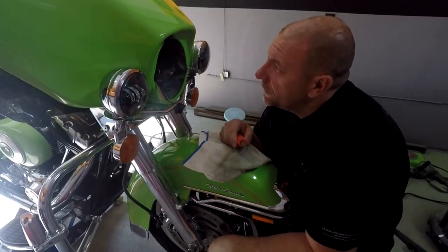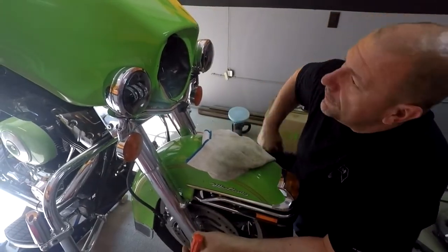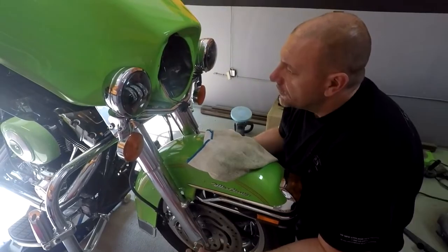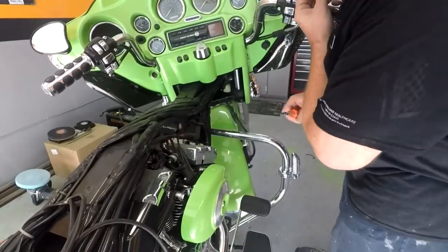Welcome back, this is the final leg home. Gonna put the fairing on — I already did behind the lights and stuff, the rest I'm gonna do on the vehicle. Now I gotta bolt it all back up. A little blue Loctite on the bottom of the screws, on all the screws actually.